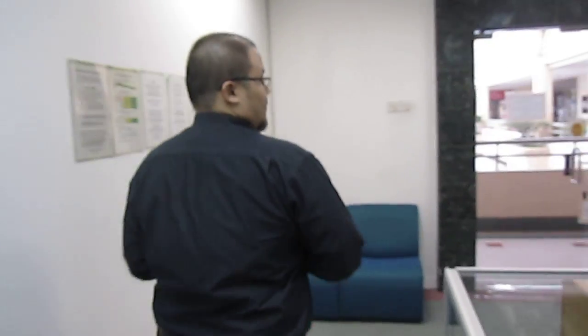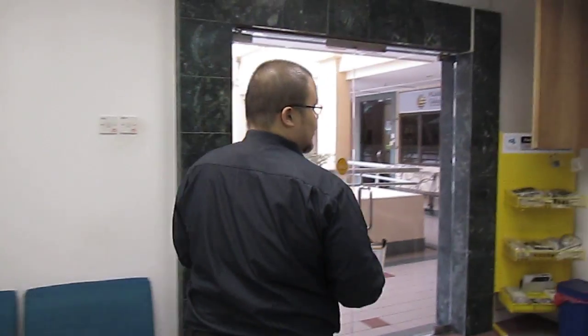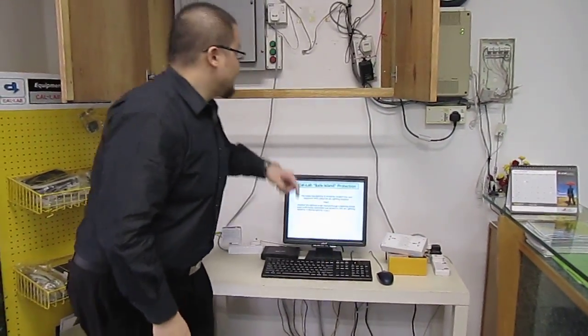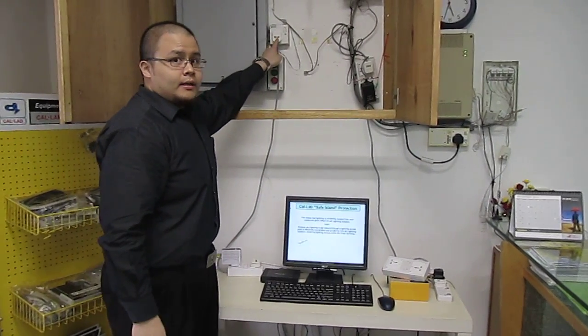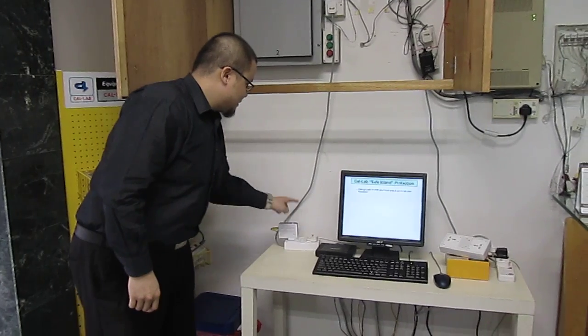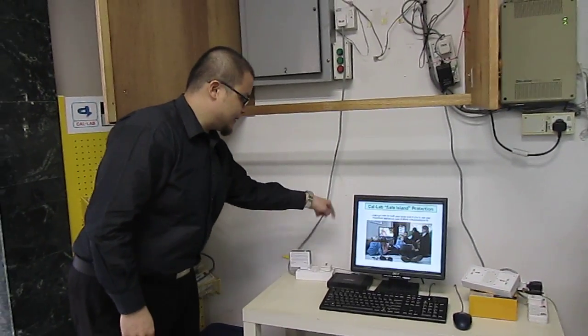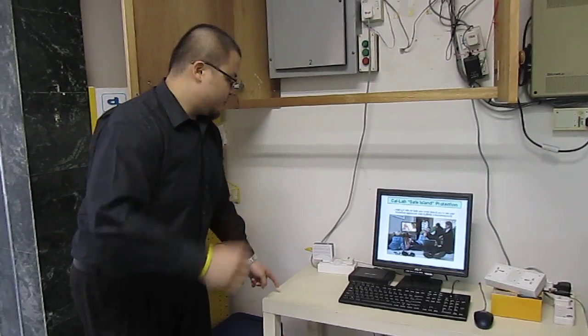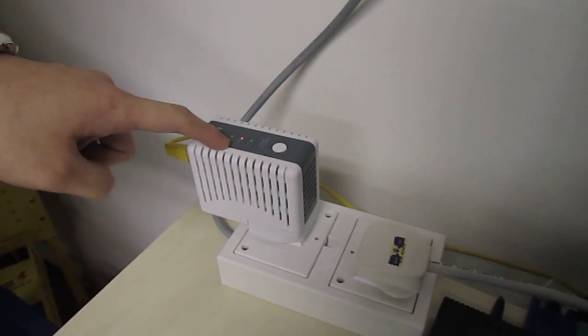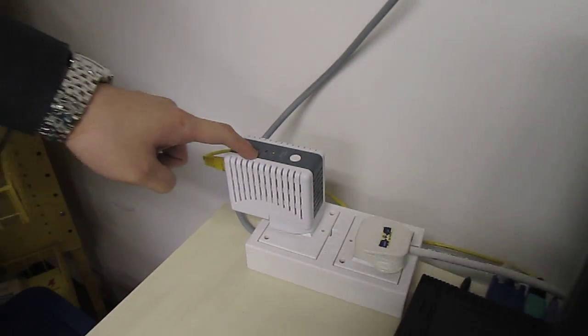On to our last workstation — our customer station. Again, we've removed the Shure Streamer. Because we only had a single wall outlet, we had to use a two-way power bar or power strip. In this particular case, the PLC adapter is again sharing the same wall outlet as its interconnected equipment. If you zoom in, you can see that the LED light on the PLC adapter is actually showing amber, which means the connection rate is subpar and unstable.